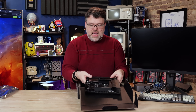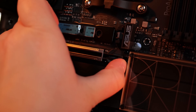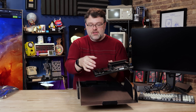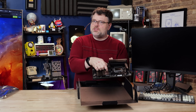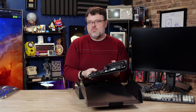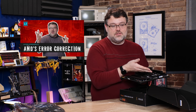That's still very nice. I'm somewhat surprised that on this motherboard, ASUS has a quick-release option to help the GPU release that is spring-loaded, but it's not a push-button release. So if you just looked at it, you'd assume these are normal PCIe slots — unlike the ROG gaming series where you hit a button and the GPU pops out. This is spring-loaded, so it's a useful feature, though the bottom X16 slot is not spring-loaded. Four DIMM slots, up to DDR5-8000. I'll be testing ECC as well as regular non-ECC memory.